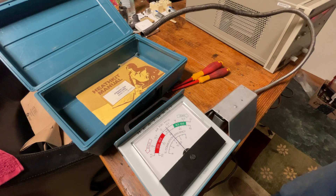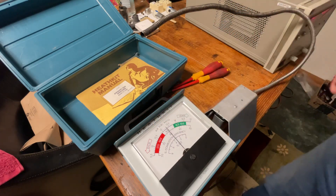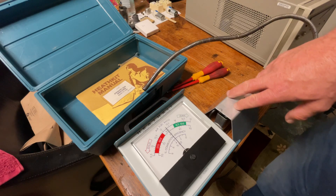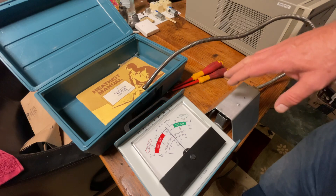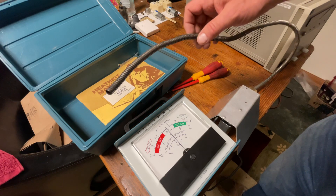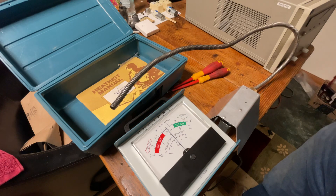Then you can adjust your mixer control. The balance has to be adjusted every time you hook this up to the car, because the balance adjustment depends on the ambient temperature these two temperature sensors are exposed to. So every time you run the system, you want to make sure before you stick this into the exhaust and start measuring that this is set to balance. I hope that explains everything.